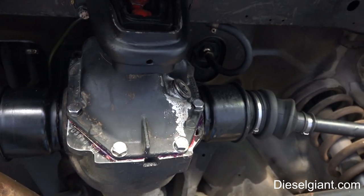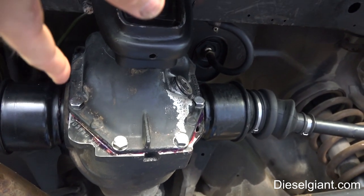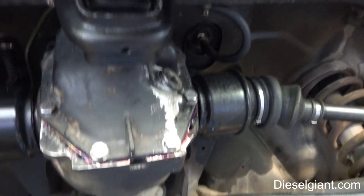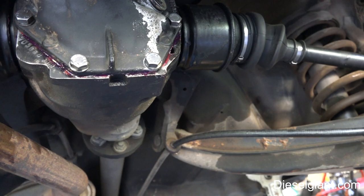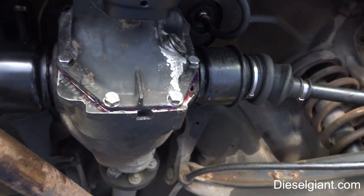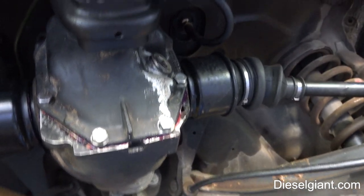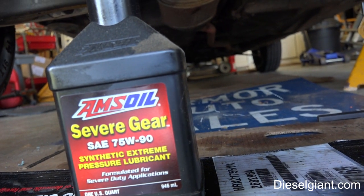When you put the cover on, most people just use RTV, but that's not the proper material. Anytime you're doing a metal-to-metal seal — especially on the rear end — you should use an anaerobic gasket sealant, which is what I did. I'll put a link to that in the description. The weird thing is some squeezed out, and it's still liquefied because it only cures in the absence of oxygen — so the stuff that you see on the outside will be gooey, maybe forever. But where the two surfaces are mated, it should be good.